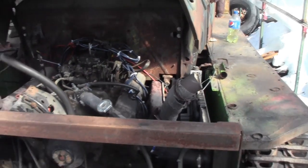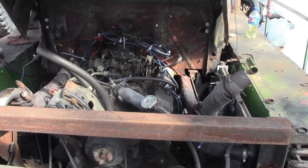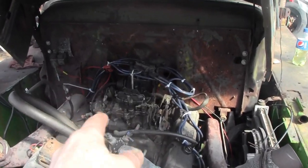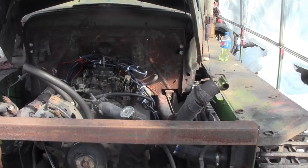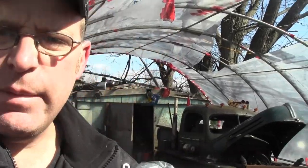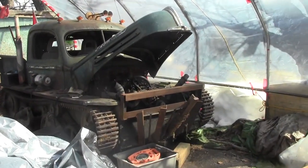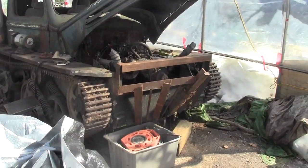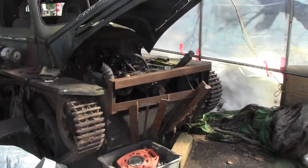The other possibility, it's an old 305, so maybe the camshaft is shot. It could be a very good possibility. Usually when you rev them though, they'll pop out of the carburetor if that happens. So I'll get it running some more and we'll get it warmed up here. Alright, so next step I think is going to be putting the timing light on it. It seems to run a bit better, but it's still not running 100%. You hear it crackling out of the left side exhaust there.